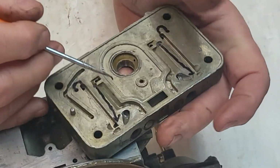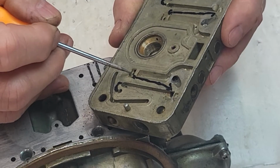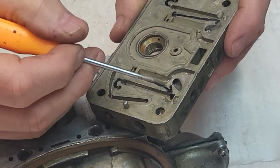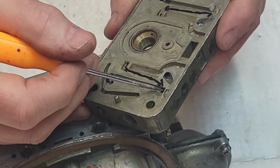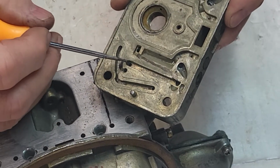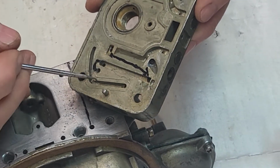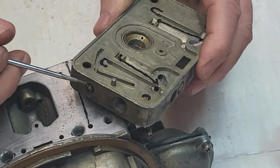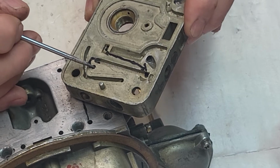Now, some people put the idle fuel restrictor down here. That's where it comes from, usually from the factory, unless it's a race type carburetor, and then they'll move it up here, which gives you a better emulsion. All right, guys, and here's where it jumps. I've just kind of outlined it where here's the transfer slot coming down, and then it jumps across here with this screw. This screw determines how much bypasses to this hole.